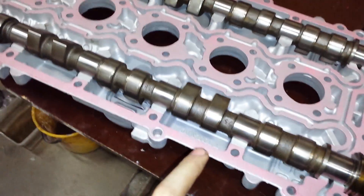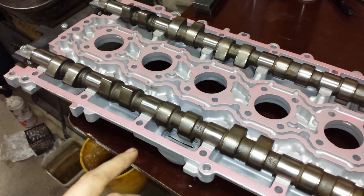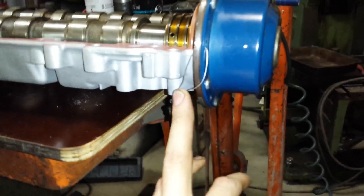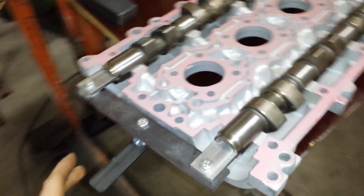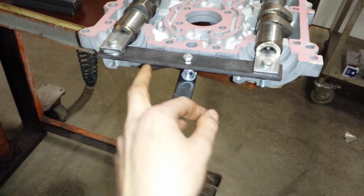This is how you do it: you apply Volvo liquid gasket on the upper part with a roller, and then you tie down the shafts with some bailing wire on this end and on this end. I made this tool — you must make something like this to align the shafts.